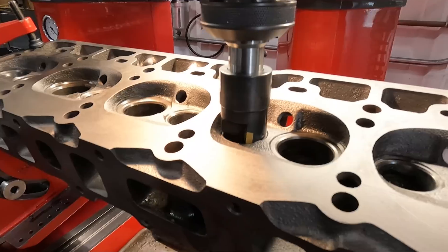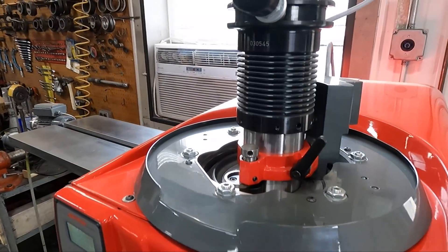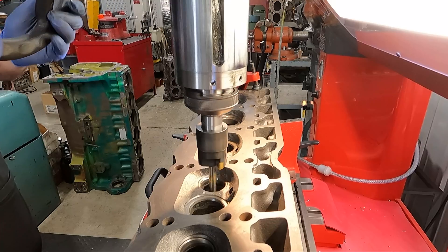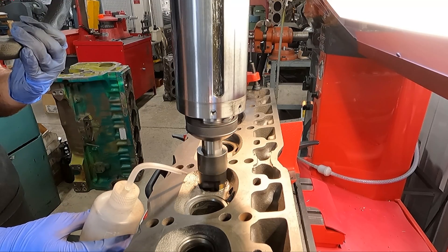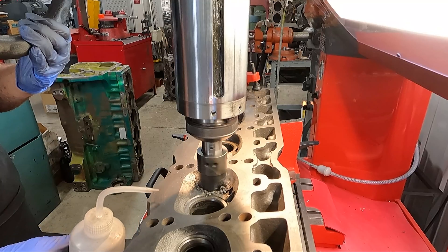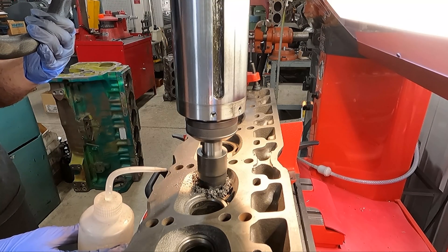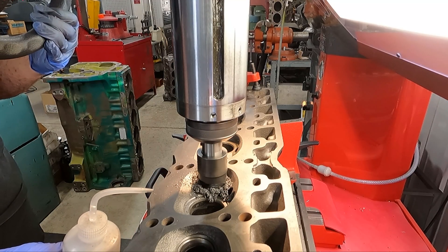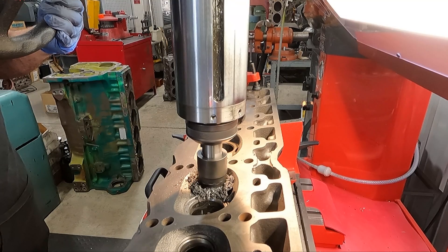With the guide work wrapped up on the TCM 25, we move over to the 30 to work on the valve seats, starting with cutting the counter bores for the new exhaust seats. We have our seats picked out and we set our spindle stop on the machine so that we can cut to the correct depth. This machine uses a live pilot, which means the pilot is spinning in the valve guide during machining, and I like to run them as tight as possible for the best seat results, which means I do have to run a bit of lubricant on the pilot. I also like to run coolant when I'm cutting seat counter bores, especially on a head like this where the seats were hardened from the factory. I'm not sure if that's a flame hardening process or an induction hardening, but the cast iron itself is hard — just not as hard as a seat insert like the ones we're getting ready to install.